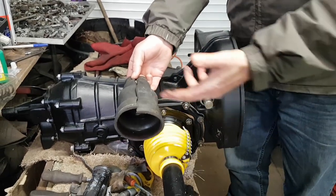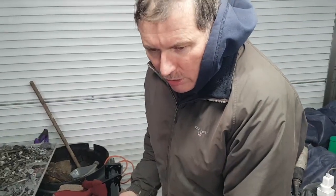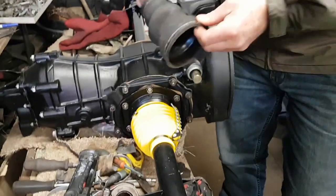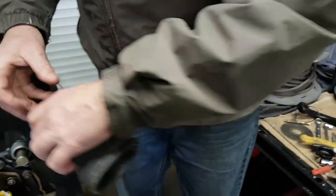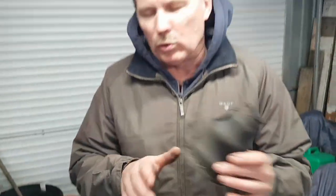So if you're putting new boots on there and you buy a split boot, you don't have to pull anything apart — you take that one off, you put that one on — that's what the split is for. And they're notorious for leaking if you don't do them right, so hopefully we get it right. There's a YouTube on there by a Swedish guy who puts one-piece boots on there and shows you how. Of course you have to pull your axle tubes out to do it. What they do is they have an expander, and they expand the whole lot, and pop it on — they'll never leak. A one-piece boot will never leak.